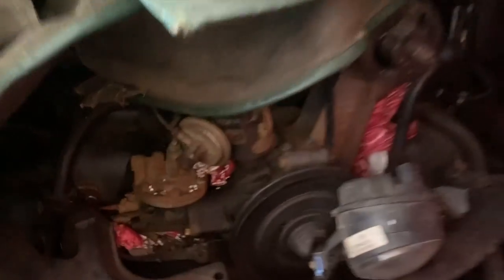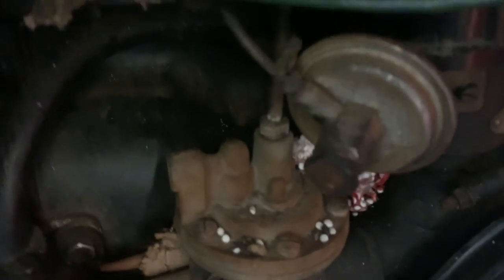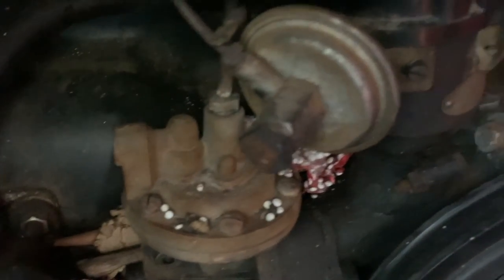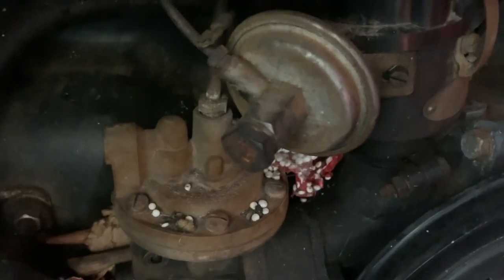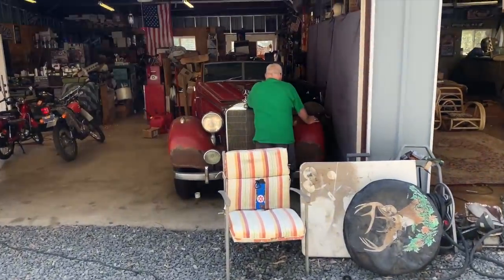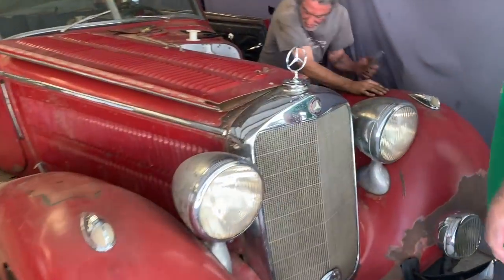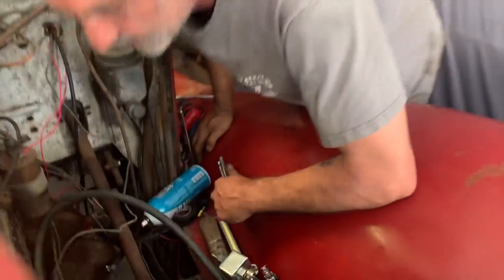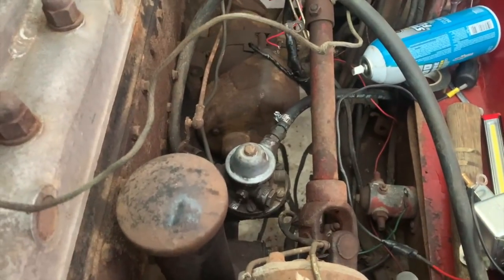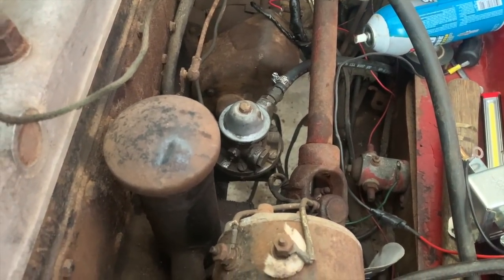So going through the junk pile here, I know I've got this 36 horse VW engine, and the fuel pump looks to be roughly the same diameter. So I'm thinking maybe the diaphragm for that is the same as the Mercedes. We might give it a shot. How many bolts hold the top of that fuel pump on there? The top of it is 6. 6? Well, then that's the same. And I swear the size of that looks almost identical to the VW.